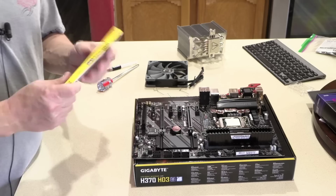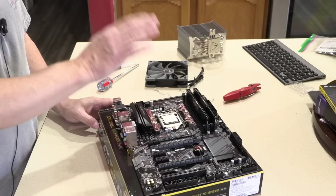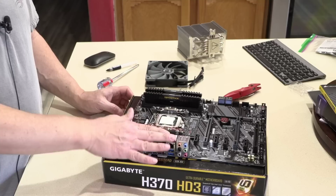Okay, so that's our motherboard prepped. That's got our M.2 drive in there, 2 terabytes, super fast storage, 32 gigs of RAM, a Core i7-9700K, ninth generation processor, eighth generation board. But as we talked about before, this $99 board, the ones I've been getting from Amazon, already have the latest BIOS. You have to have the latest BIOS for the ninth gen chips to work.